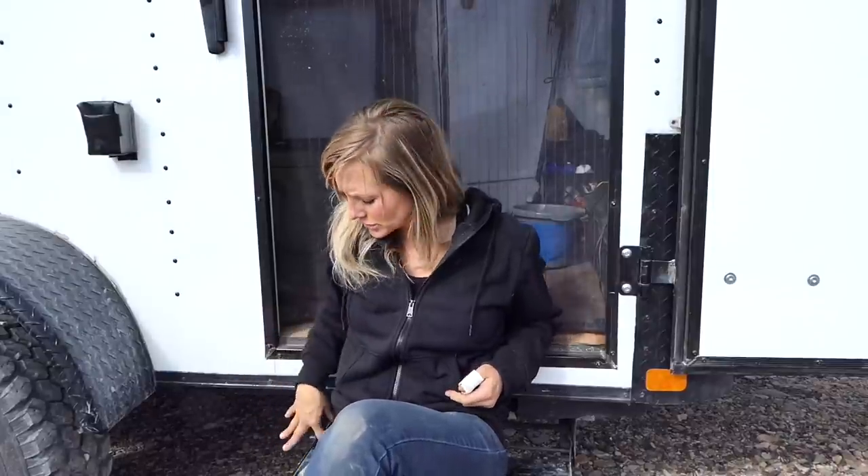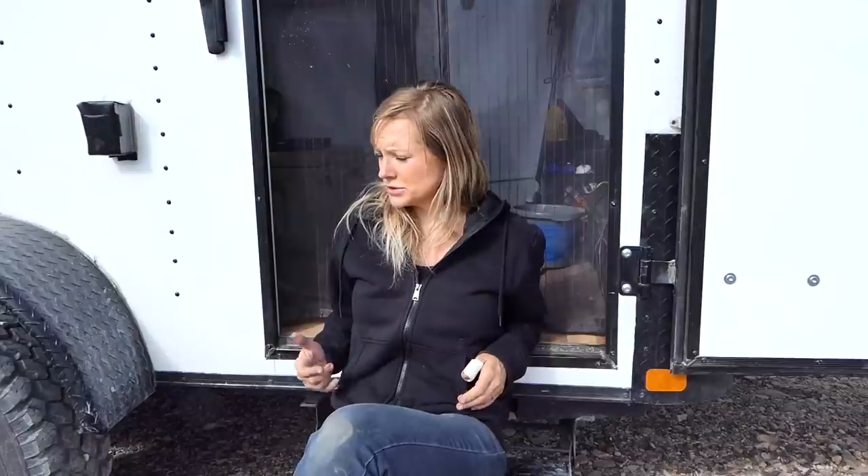The fuel filter was broken — you can see the tip of it is curved up and kind of broken. The fuel pump itself, while it was making noise, wasn't actually pushing fuel. Back when I did the installation, a viewer named TST UDT Ojibway mentioned to get extra fuel pumps. Well, I do want to thank them because the fuel pump was in fact out. I took pictures and video and sent it on to the company, and even though they're all the way over in China they're giving me really good customer service.